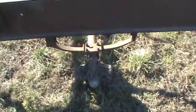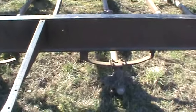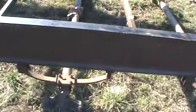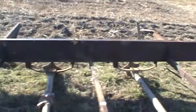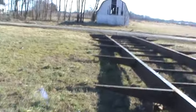I might still be able to use those hubs, but I've got to check — they may not be road worthy for driving down the road all the time. The springs, I doubt I'll reuse them. Some of the springs are all wallowed out from sitting, and these are all rusted out, so I'll get all new leaf springs and hardware from tractor supply to mount them up right. I'll do a tandem axle — take these two sets of axles and move them up. With two axles you get a little better stability; you don't get the swaying and jackknifing going on.